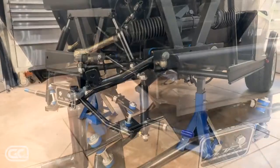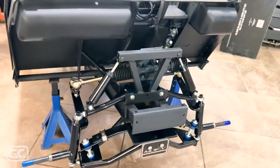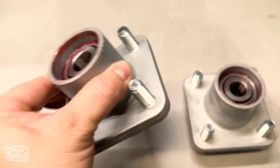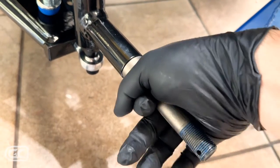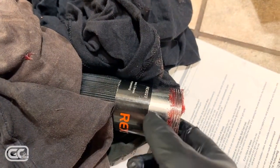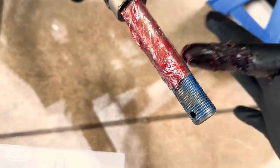I have my bearings packed — everything is new: new hubs, new boots, new seals, new everything. I got all this for about $60 — I'll put a link below where you can get these hubs. Now I'm going to get them installed on the lift kit. I've taken the boot off the spindle and cleaned it to make sure there's no sand, dirt, or debris because that will eat your bearing alive. I have some grease from my gun — about that much — and I'm going to get a little bit of grease all over this spindle, but not on the threads because those have thread locker on them.